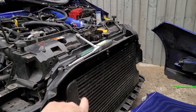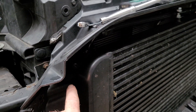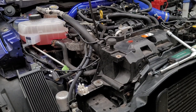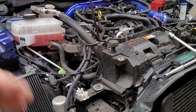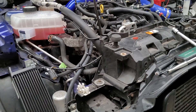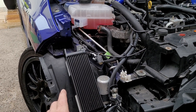The air con is probably blocking too much flow. I've got the pipework for the oil cooler there because the oil cooler is sunk down behind into where the crash bar is. I've got an Air Tech rad, and I've got the Puma Speed poly pulley on there. The idea was that because I'm running at such high RPM it would slow the water pump down at six thousand plus, to stop it cavitating. In hindsight that's a bit junk — it's going to come off, going in the bin. Apologies to anyone who watched that video and bought one.